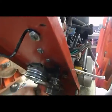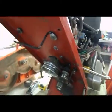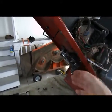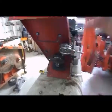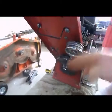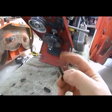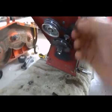These heads were literally sticking out about a half inch down below. I bet you, if you have a Swisher and you put your hand underneath here, right underneath where the solenoid is, you'll feel these two screws sticking out. So every time you go to engage the belt, it sort of bounces a bit in there, as it engages the pulleys on both sides. And I think that up and down bouncing was catching the top head of these screws. They're self-tapping screws, very sharp at the edge here, and I think they were chewing on my belt a little bit every time.